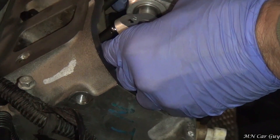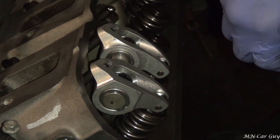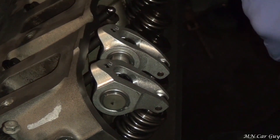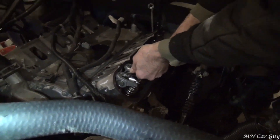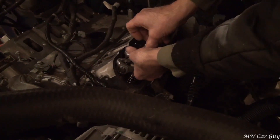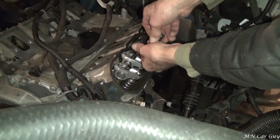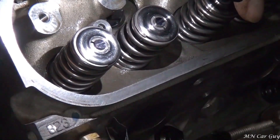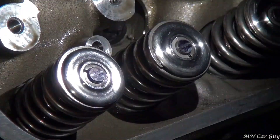The instructions say to install them without any shimming. Just make sure everything's lined up and put oil on the threads, then tighten to spec — 25 foot pounds. We're going to rotate the engine and see what our mark is going to be. It's the moment of truth. We've rotated the engine one full revolution, which has actuated both rockers. With the cylinder at top dead center, we're inspecting the mark of the roller to the valve stem, hoping to see it in the middle. Look at that — it's almost center. That's riding right at three and six on that one, and this one is the same way. I'm happy with it.